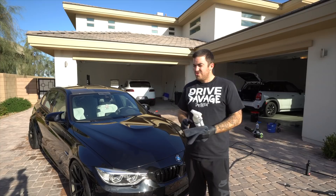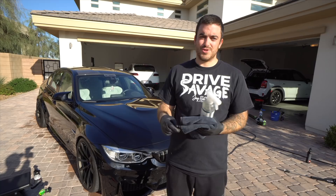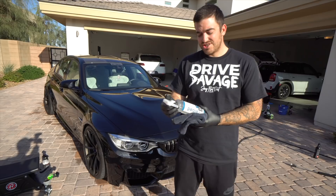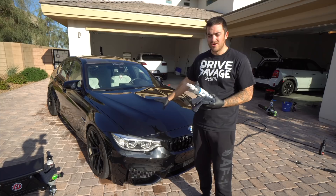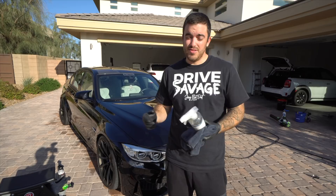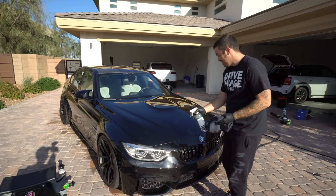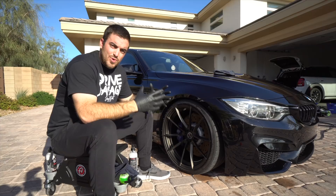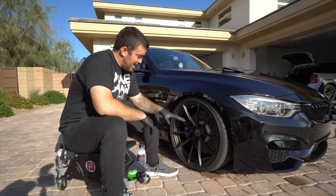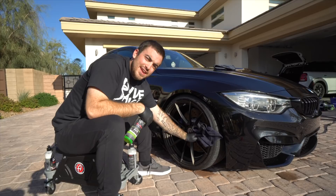Anywhere that gets high traffic — front bumpers, top of the hood — it doesn't hurt to have an even better level of protection. After the Jay Leno's Garage Evaporate, we're going to use CarPro Reload, which puts a silica sealant as one more step of protection on the high-abrasion areas. It's a water and dirt repellent that lasts up to about six months — great for our dusty Las Vegas environment. Give it a good shake, apply it over the hood, and do a nice one-wipe for each section. Back at the wheels, there's some overspray on the spokes from the soap — use an all-purpose cleaner and a dark towel to remove any soap scum left over.